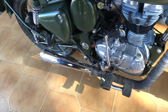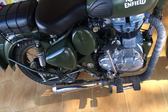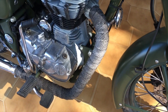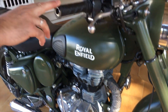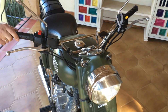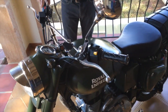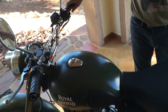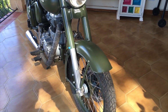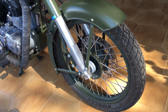The extras on the bike when I bought it include a reverse cone exhaust system, which is an aftermarket piece at about £55 and makes it sound really nice. The original exhaust is much longer and I much prefer this — it looks better and sounds better. I put some exhaust wrap on the front just to make it look cool. The handlebars are also an addition — they are trial-style handlebars at about £33. I prefer the riding position to the original bars; easy to change, you just have to drill two holes.